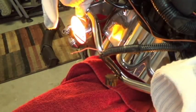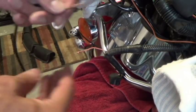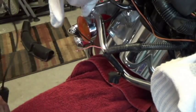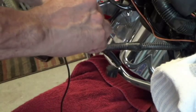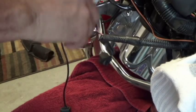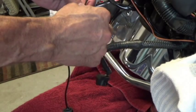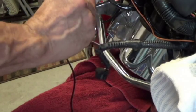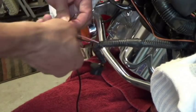It's real simple. I stripped these wires here off camera — in this particular adapter they're very small gauge wire. Basically we're going to twist the wires together so they make a good electrical connection. I'm not going to tie wrap them or do anything yet until I test this to make sure the thing works. You don't want to make a permanent install only to find out the transformer doesn't work or there's no power to it. So it's connected.